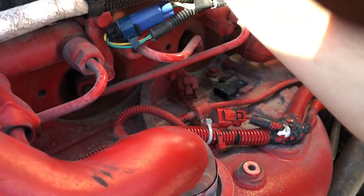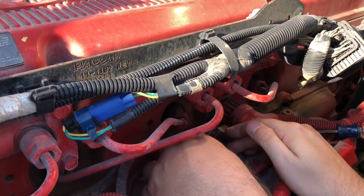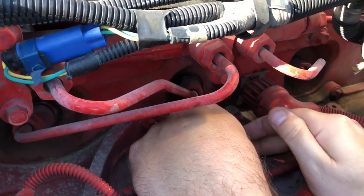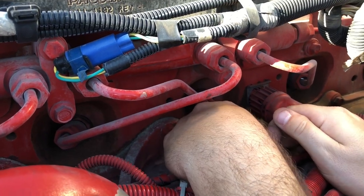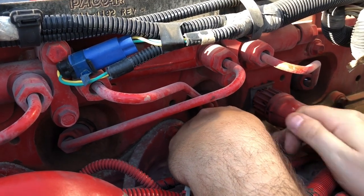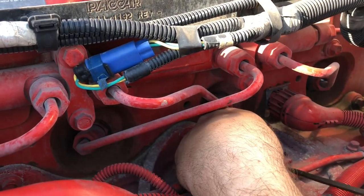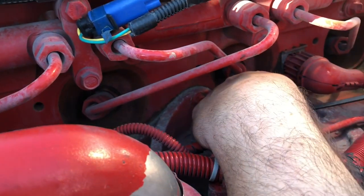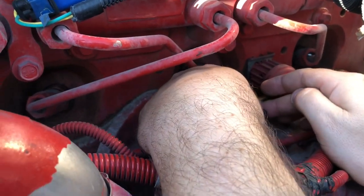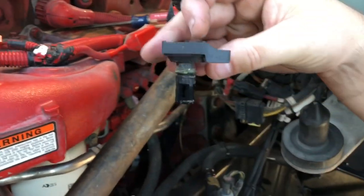From there, I urge you be careful with this. What you want to do is try to rock it, slide it back and forth. You don't want to cock it side to side - you want to keep it straight. So when I pull this out of here, just back and forth like you're trying to turn something, and just put with your finger just a little bit of up pressure every time. We're going to try to ease it out. We're going to try to pry just a little bit - not enough to break something, because keep in mind we're dealing with plastic pieces. When you get it loosened up like that, pull it real slowly out. There's 85,000 miles right there.